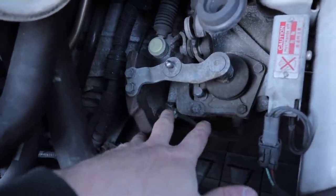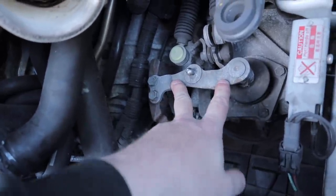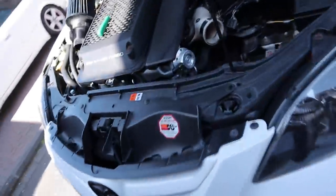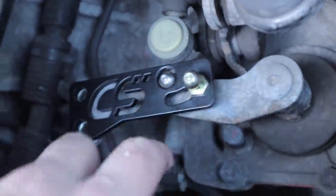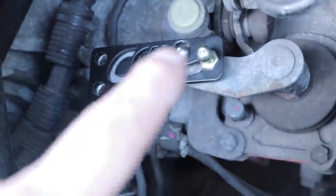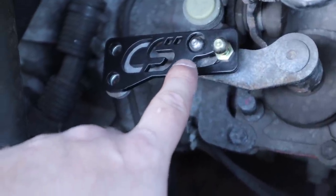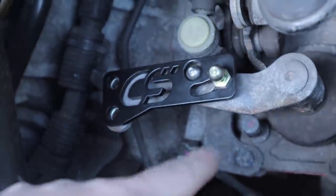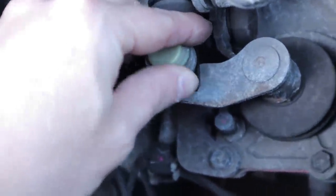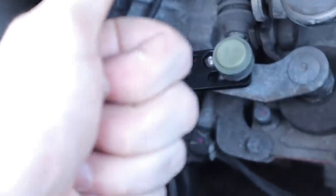The bone thing stays on and you kind of replace the original plate around it. I'm going to undo the weight and then we're ready to put the CorkSport one on. The old weight is out and we're in the process of installing the new one — the old linkage doesn't actually get used anymore. This shift plate can go from 20% shorter to 40% shorter. All the way to the right is 40% — we're going full send, all the way to the right.